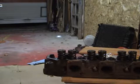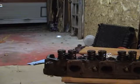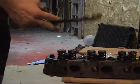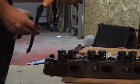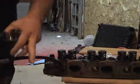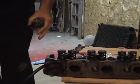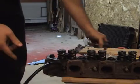To begin the process, you're going to have it stripped down this far, and one of the first things you're going to have to do is pressurize the cylinder with air. In order to do that, you'll have to put a hose in there, which I've done with a compression gauge. I removed the Schrader valve in the end of it, so that you can put air pressure into the cylinder to hold the valves up inside the head. What you do then is you connect an air compressor to that line, and just to save noise, I'm just showing this as a demonstration.